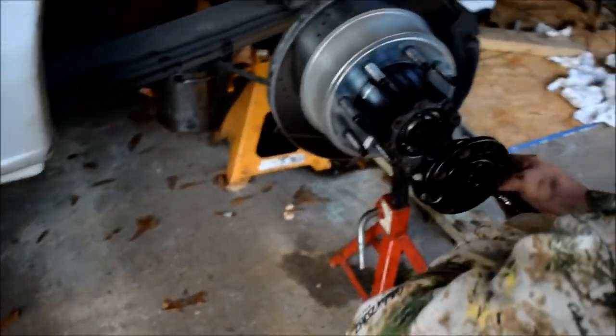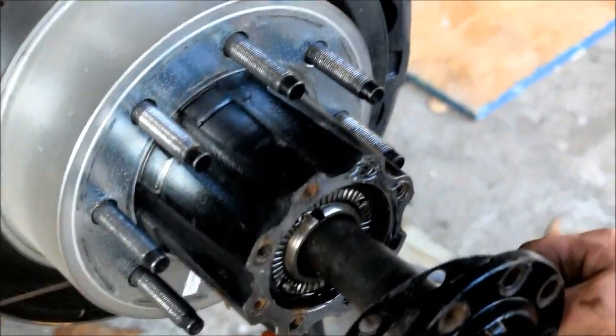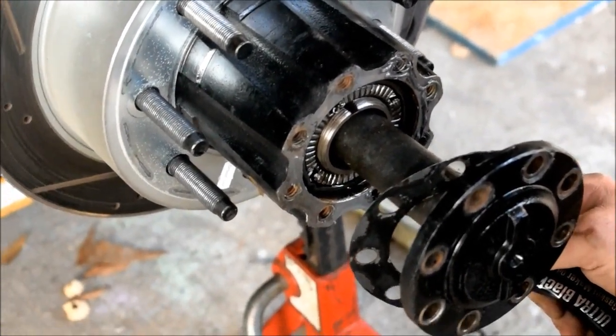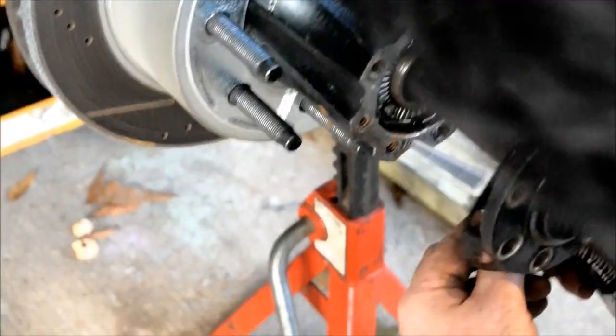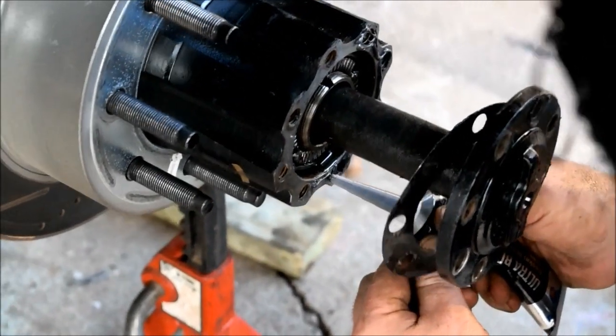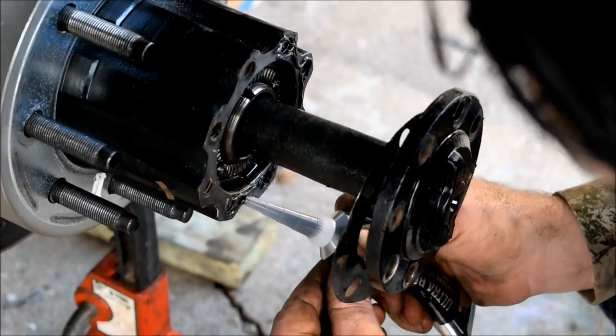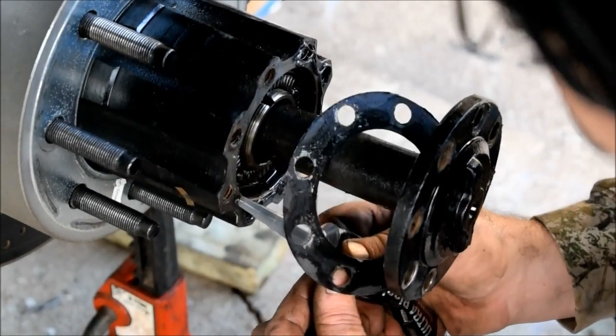These bearings were previously done, and they were just checked on other prior videos on my channel. So we're confident that these bearings are good because they were replaced and it wasn't that long ago. So I'm going to Permatex this because, like I said, I don't like rear end fluid inside my center cap.